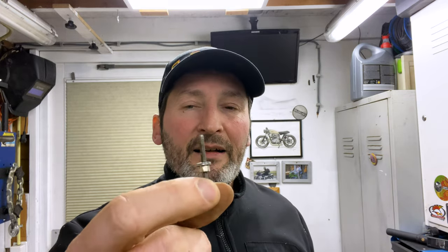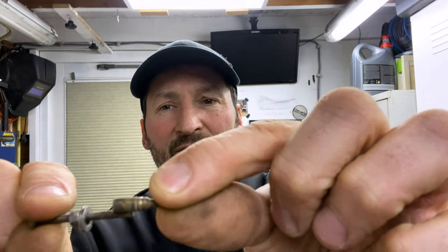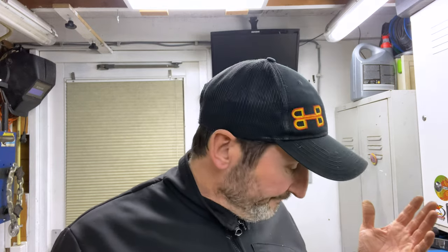You could make it a bit more safe if you go a thread size smaller. This is like M3 — if you go smaller, you have a bit more room if you make a mistake; you can go from M2 to M3. But this should work as long as you don't drill too far in. There is plenty of material on this thing and you can go pretty far with that screw. I've only gone this far and that's enough to get it out. I hope it helps — like my videos, subscribe for more GL1100 videos and tips, CX500, Suzuki GS450. Thanks for watching.